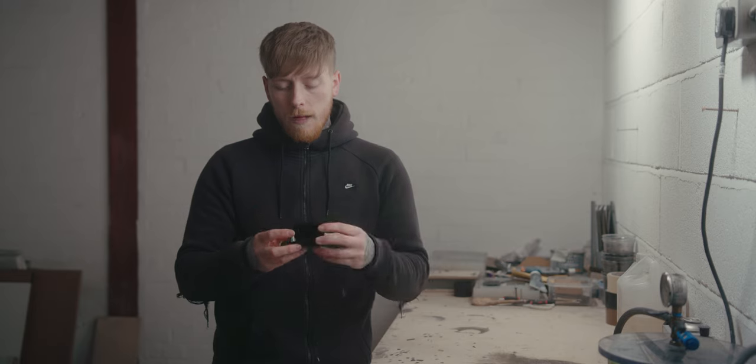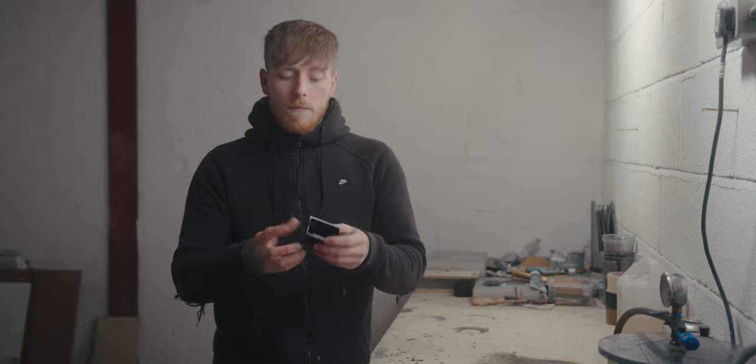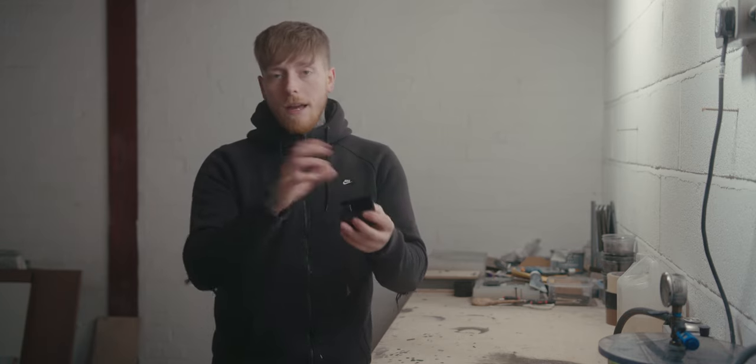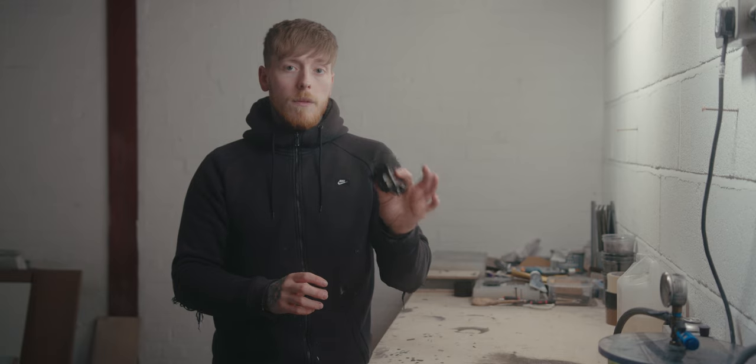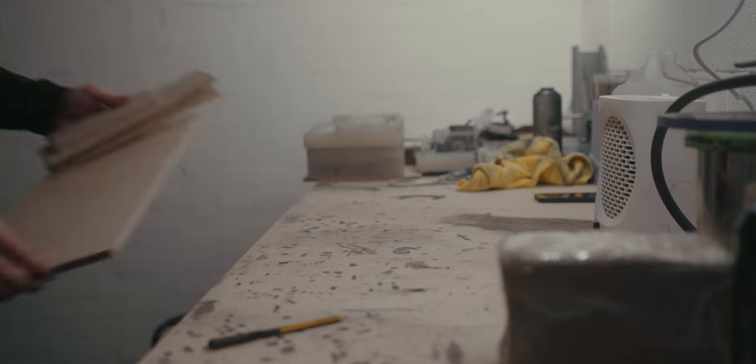What I've come to is: I can take a mold of it. I do mold making as another part of the business and manufacturing products, so I've got all the tools to hand. It's not much more effort to take a mold — I can get an identical part, fabricate my mount into that one, and leave the customer with the original. If he ever puts it back to stock, he's got the original to just drop straight back in.